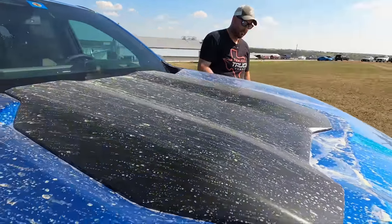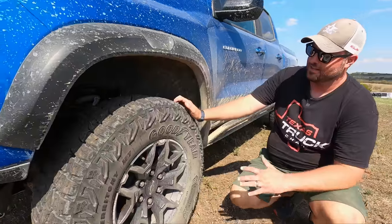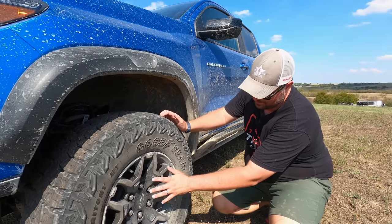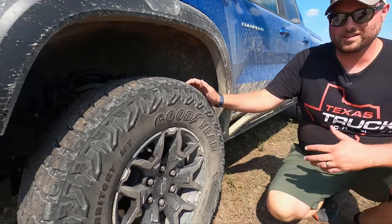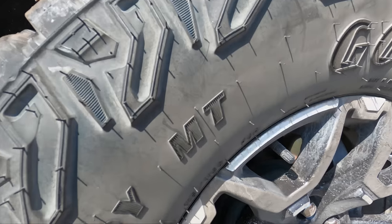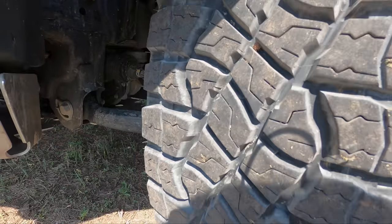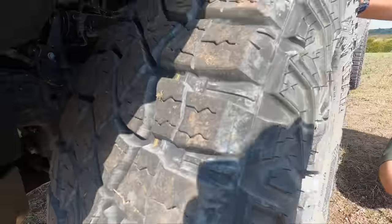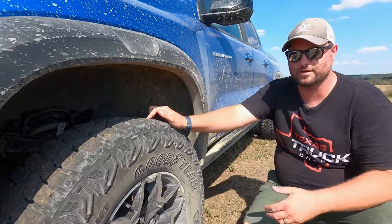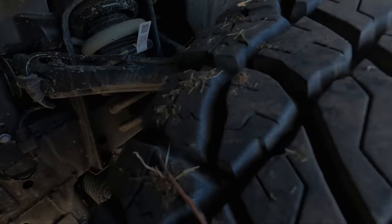Let's check wheel and tire. I'm so happy about this — 17s, not 18s, not 19s, not 20s. You've got a properly sized wheel with big enough brakes behind — actually four-pot brakes, great in this, no complaints. Your Goodyear Wrangler Territory MTs — MT is maximum traction — these things work great on lots of terrain, rock solid. This is a 285/70R17, shares a lot of sizes with Wranglers so there's a lot of aftermarket options if you want to change to KO2s or a full mud terrain.